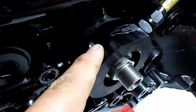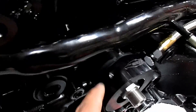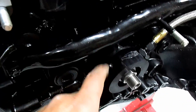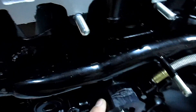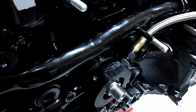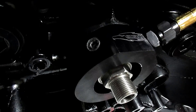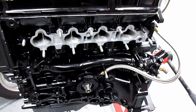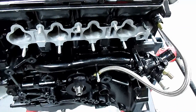The spare port can be used for oil pressure or oil temperature — though for oil temp you'd want to pull from the pan. In our case we're just going to plug it — RTV it, plug it, tighten it in, smear the RTV, and clean it off. This finishes off our VTEC conversion kit.